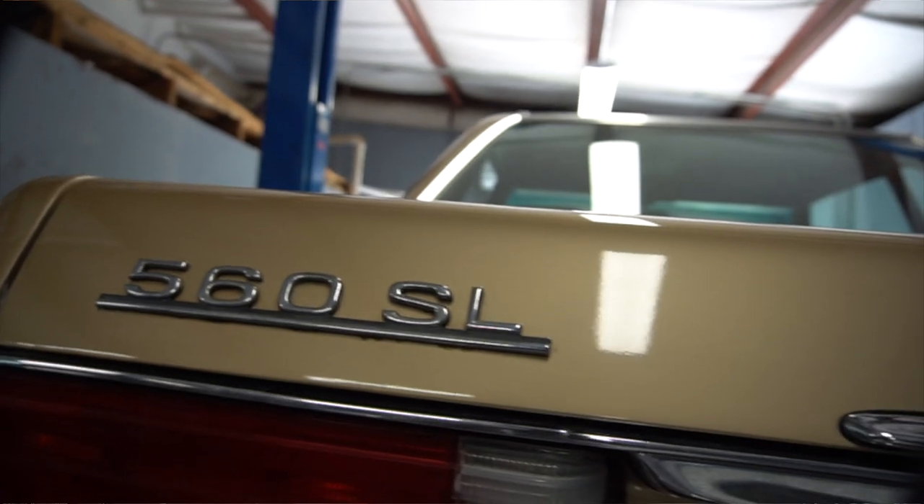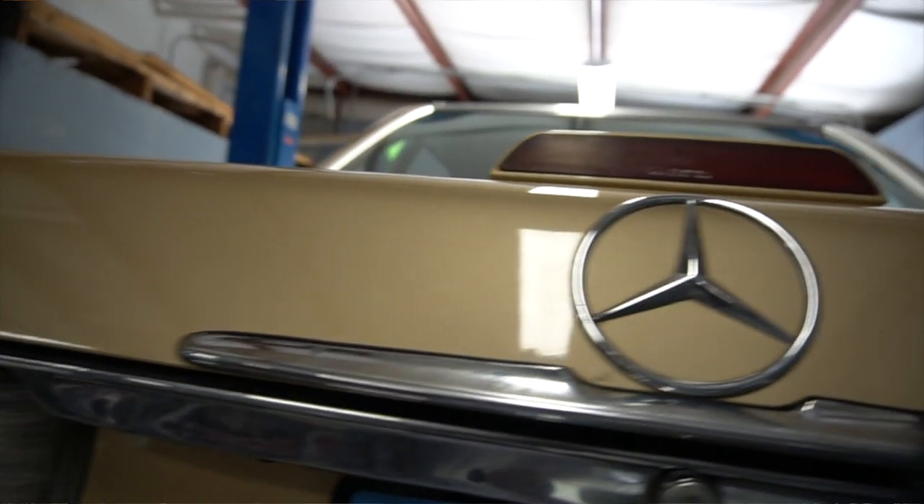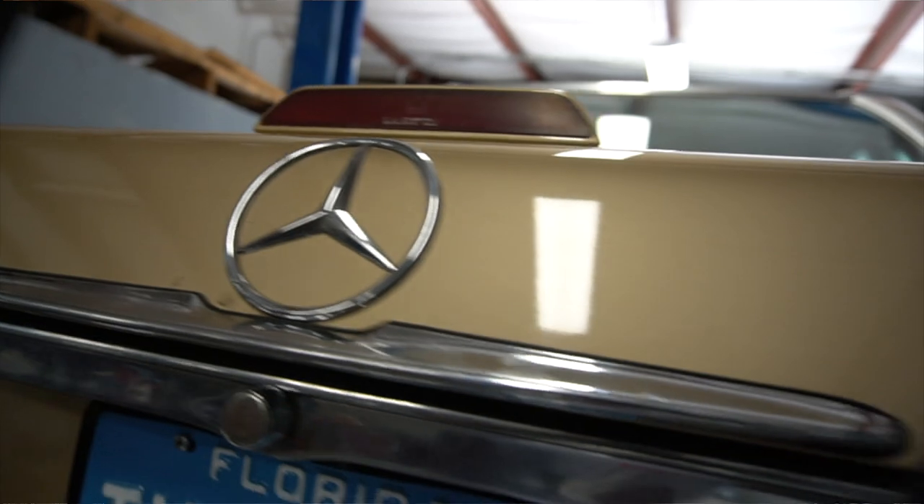A lot of people I know often do not check these parts, but if you don't know their last replacement date, it's a good idea to check them annually. If you go to Mercedes and buy just the subframe mounts, they're $57 each. The motor mounts are around $118–$120 for one, and just over $100 for the other — so they're not particularly expensive. There's also some other hardware: a little rubber pad that goes in the motor mount bolt, a clear rubber guide for the subframe bolt, and a little rectangular nut for the subframe mounting bolt. All of these items are available from Mercedes, even though they don't come as a kit.